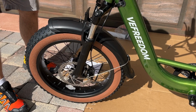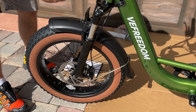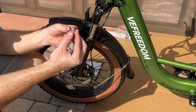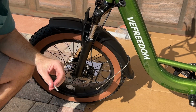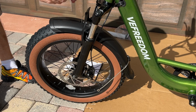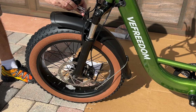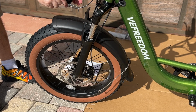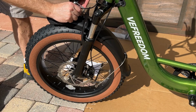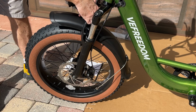And you're going to take the headlight, make sure that it's not wrapped around the handlebars like that, and you're going to use the 5mm bolt with the lock nut that's on the back, and you're going to install that up here. And what you want to do is put the headlight mount like this with the fender and put the bolt through like this, and then the headlight, and then those go through the fork mount here.